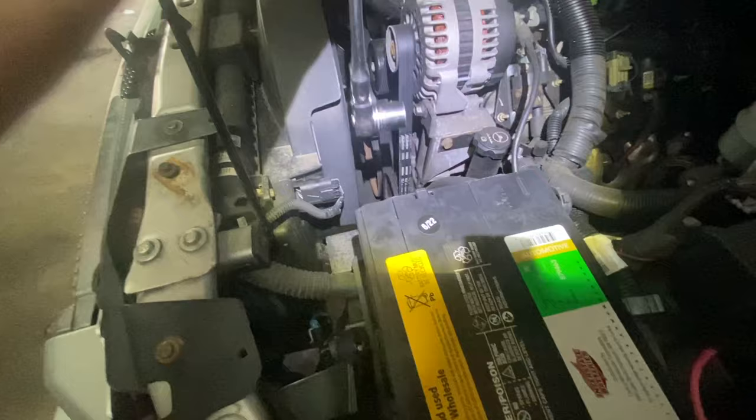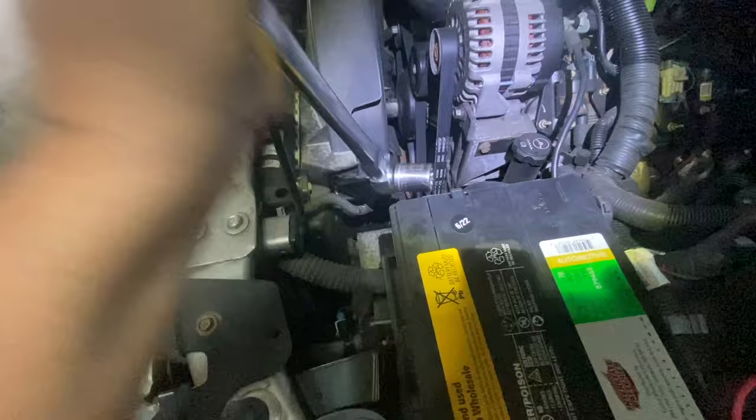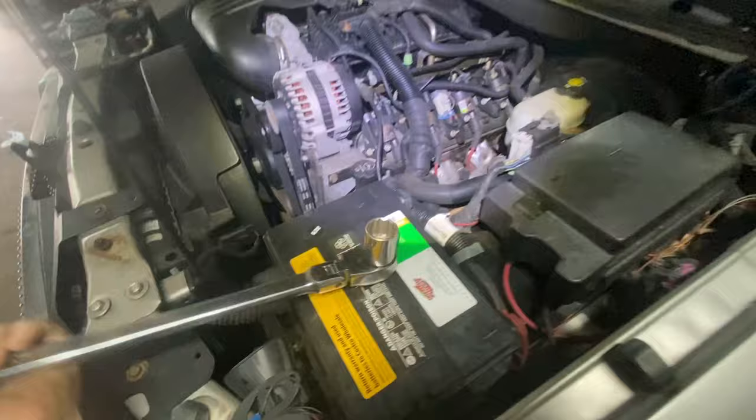You just put a wrench on it — it has to be a long one because you've got compression in there. If you can't turn it with your hand — see, on this eight-cylinder engine you can turn it nice, no problem. But on this engine I can't, it's locked. So that means it's seized.